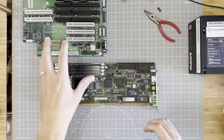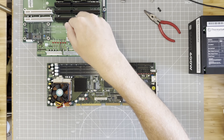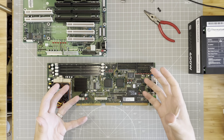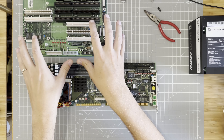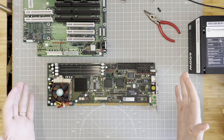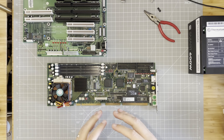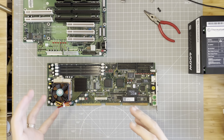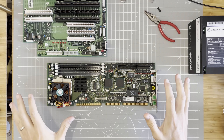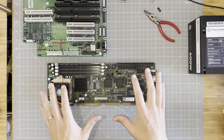And expansion — the PC connects to the PCI and ISA bus through these slots, and you can add your add-on cards here on the backplane. This is great in an industrial setting because the backplane is super simple — just sockets and power — so it's very unlikely to fail. And the machine, which is the complex part, if it fails, you just take the whole card out, put an identical PC back in, and you're back up and running. You don't have to troubleshoot whether it's the RAM or the CPU; you replace the card and you're good to go.